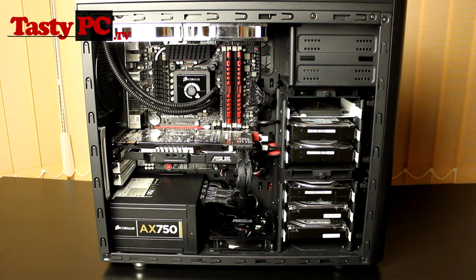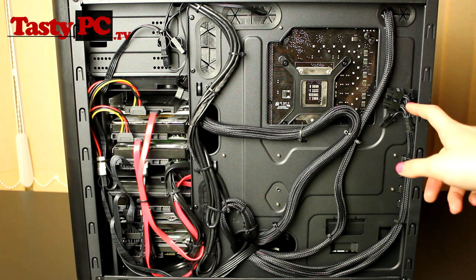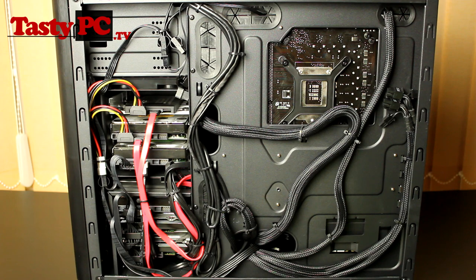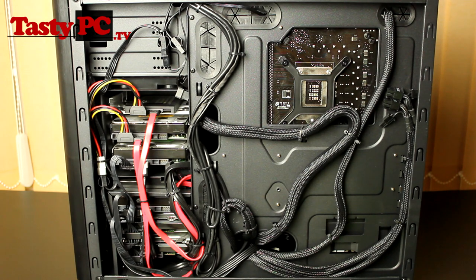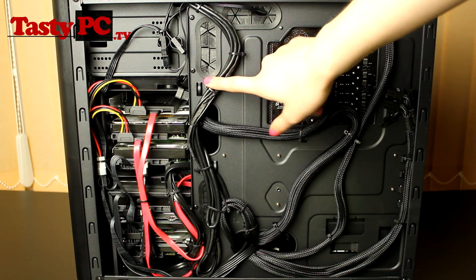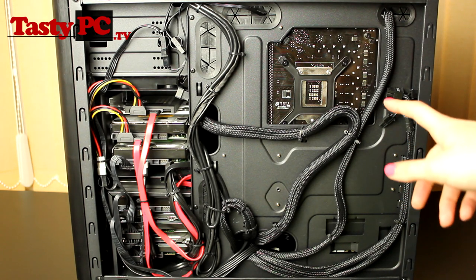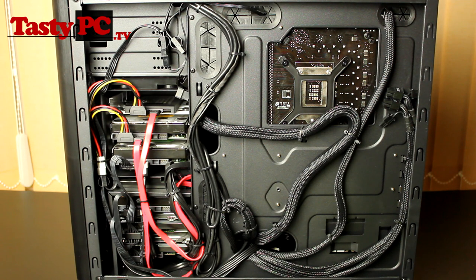Now I'm going to turn the case around and show you the inside of the back. Looking at the back of the case, as you can see there's my really awful cable management. I did leave some extra PCIe connectors just in case I ever decided to do SLI in the future. I've already removed the back side panel which was just plain — it slid straight off as easily as the top panel and the other side panel. Because of the size of the case there's not a lot of room for cable management and if you're using thicker cables like this you can't have them overlap. When putting on the side panel you do have to do it with a little bit of force, although you do have plenty of room behind the back of the hard drives for cables. You've also got lots of these tie points for cable ties which I love. The CPU backplate cutout is actually too high for my motherboard and I did have to remove it to fit the H100 — I think Fractal Design could have probably done with just making this a little bit bigger.